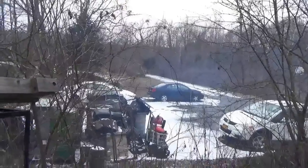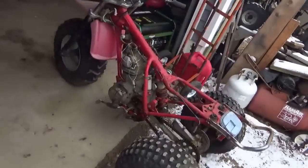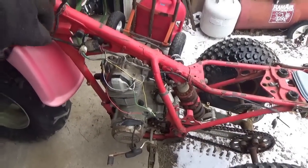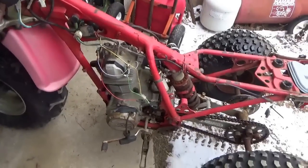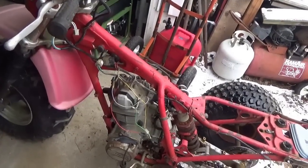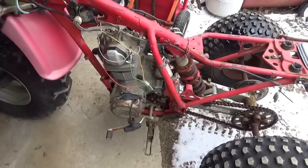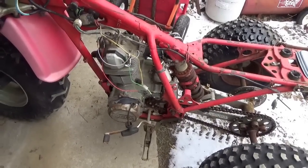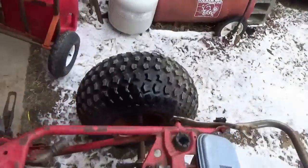Neighbors are going to be talking — what's that plume blowing over from Spooner's place? Anyway, I got the 200S running on the 200X ignition system. I think this ignition system, being a little more high-performance, has a tendency to lean the spark curve to be a little more advanced — even when the thing is just starting. That's kind of why I think it was fighting me a little bit. I took the plug out and the plug was a little wet, as in oily.